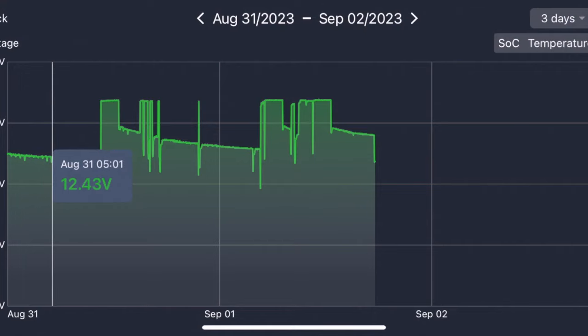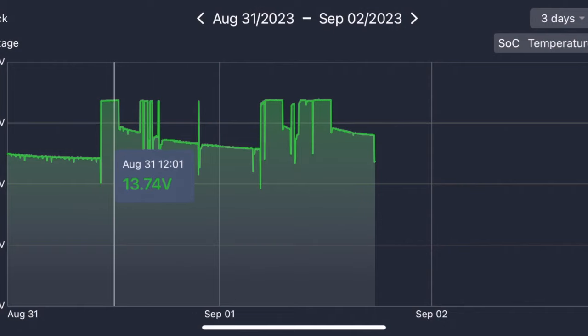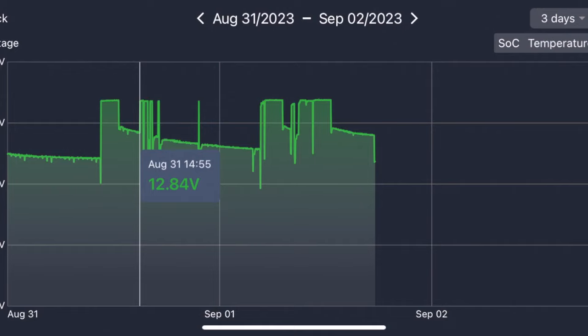When you see the graph sloping down, that means the battery is discharging. These batteries are small, so they discharge fast, and the only way to save them is the car topping up the battery. As you can see, it gets down to about 12.4V and then we drive the car. We drive probably every day twice a day, so we're probably not going to have issues. But if you only drive every few days, this slope is going to hit 12.1V and the car will have to charge the battery within two or three days.